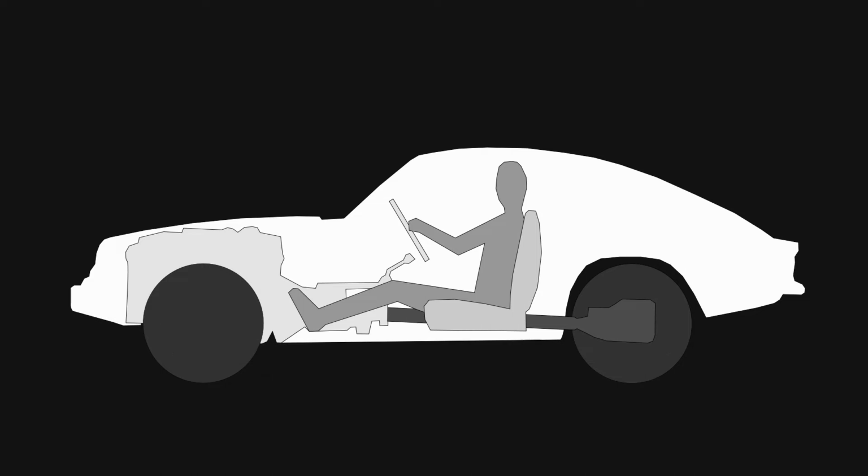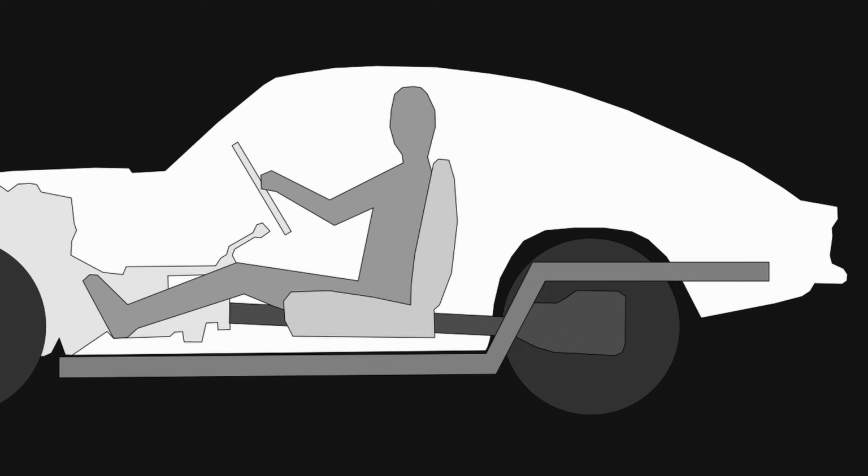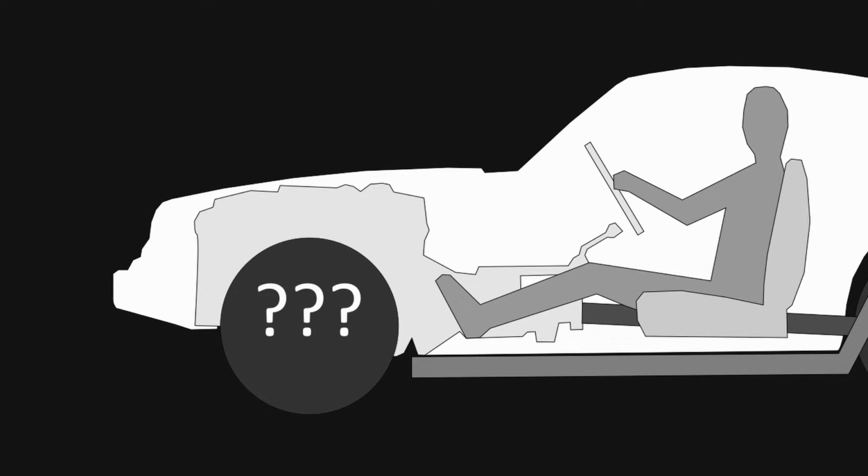The plan then is to have 2 large beams running under the main body shell with bends at the back to accommodate the diff. Later, once the body is off the rotisserie, we'll fabricate the front as a second unit and make sure the spliced area is well reinforced.